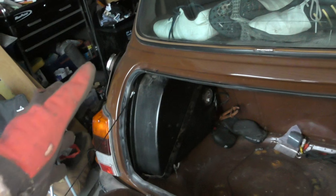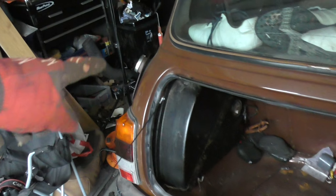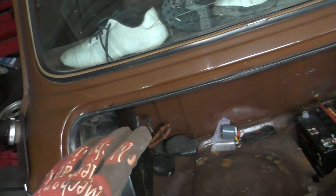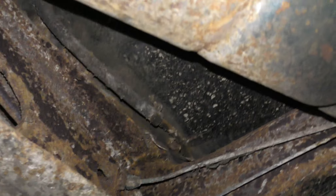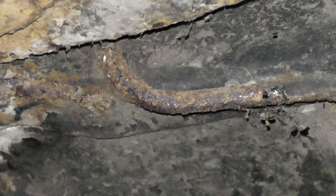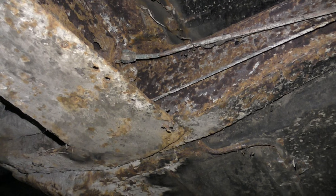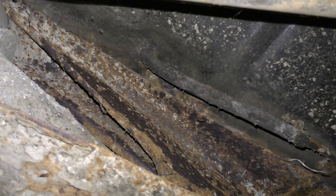With a strap off the fuel tank, which should hopefully wiggle free, there's already a clamp down the back on the fuel pipe where I disconnected the pipe from the front. Take the fuel cap off and the tank should wiggle free — I'm going to try to leave the tank in situ. I don't particularly want to drain the tank but I might have to. This pipe here, that's the fuel pipe. It looks a little bit crusty, coming behind the subframe, and I think I'm probably going to have to replace that. So the fuel tank has to come out. Bit of a pain but never mind, at least we get it done properly this time around rather than faffing around. That pipe there goes up into the floor and then connects into the bottom of the fuel tank.